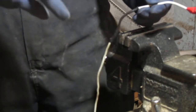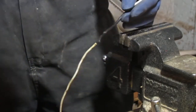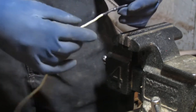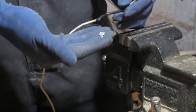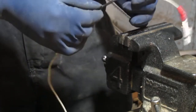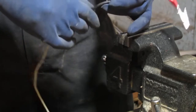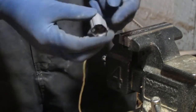Don't forget, the most important thing I thought about is to make sure you cover all the area around the vehicle speed sensor with a rag or so, because when that hot metal falls, you're done. It'll melt a hose or something. It destroyed my variable speed sensor. I couldn't even put the connector on, because it dropped down inside a little gap where the connector was.